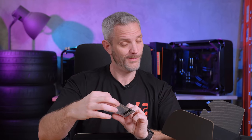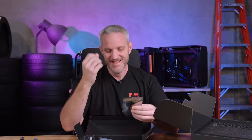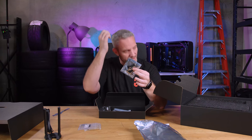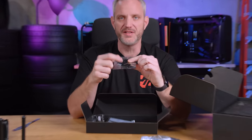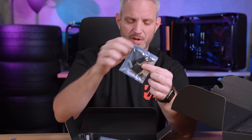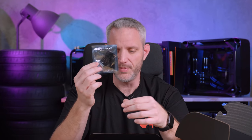There's also a probe cable. All Dark motherboards come with this attachment that connects to the motherboard, giving you an easy spot to use your multimeter to check voltages going to different parts of the board. When you're doing extreme overclocking you can't trust software voltage readouts — you need hardware-based voltage monitoring to see exactly what's happening. That's on every Dark motherboard.